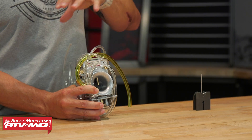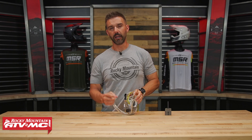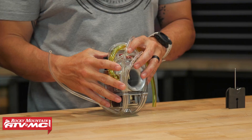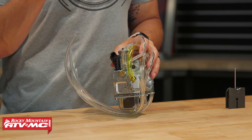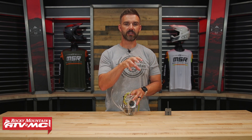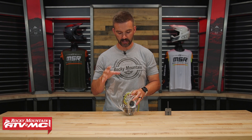That's something Lectron has been chasing, and that's why they have the Billitron Pro. With that new tailored bore design they're getting more airflow going through. The torque jet gives you adjustability from throttle closed to about halfway, and then the power jet — which was on the previous Billitron — gives you from half throttle to wide open. So now you can adjust the torque jet and the power jet to get the engine character you're looking for. If you want a snappier bottom end that builds power super quick, you can do that with the torque jet, especially with that additional airflow coming through.